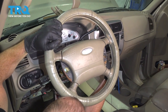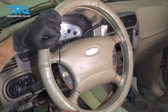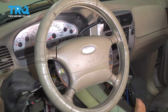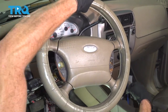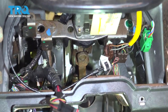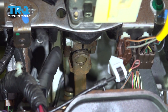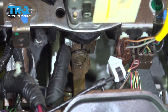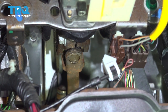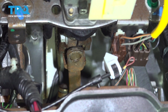Now we're just going to make sure we have the steering wheel in the locked position. Let's go ahead and take the key out. Grab that steering wheel — make sure you hear it click so it cannot turn. Now let's make our way underneath the steering column all the way to where the steering shaft goes down through the firewall. You're going to find that the steering shaft has a 10 millimeter pinch bolt that goes straight through it and holds it to the steering column. We need to remove that pinch bolt and then slide the steering shaft off of the steering column.